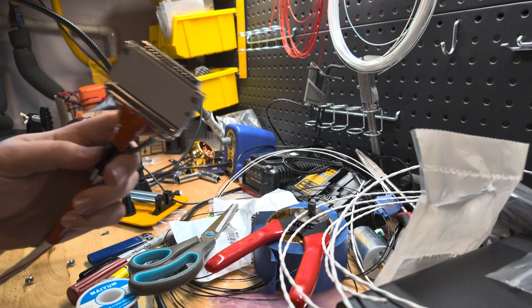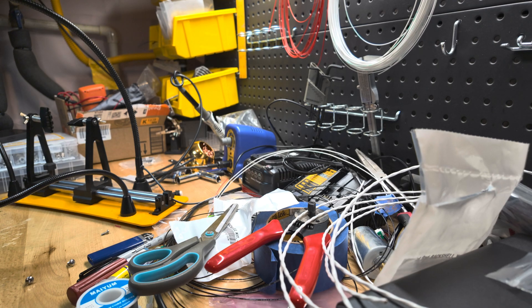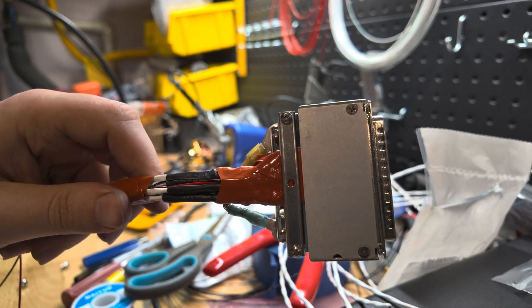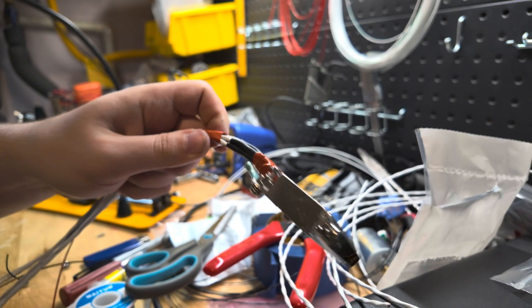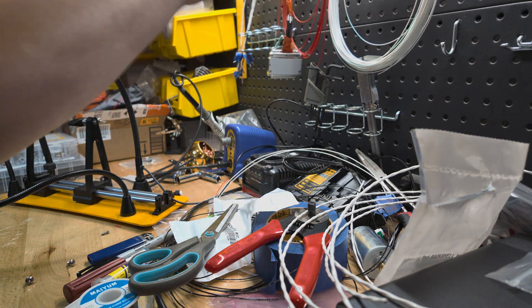We're going to completely ignore what I was doing in this video, because I did all that fancy stuff putting the silicon tape on there, but I actually ended up needing to take this connector completely apart. A lot of those wires I did end up reusing — removing the pins and putting them in a different connector or even the same connector — but don't make the same mistake I did: do not close up any of your connectors until you're done with pretty much all of them, because you never know what you might end up needing to interconnect between the two.